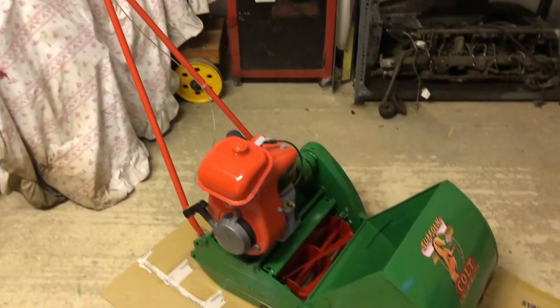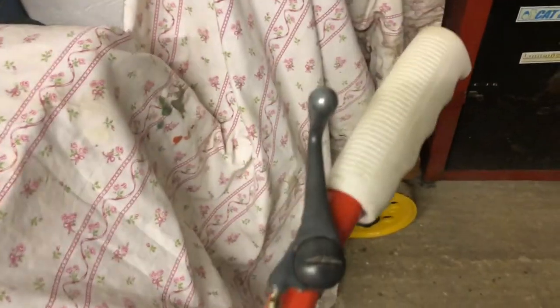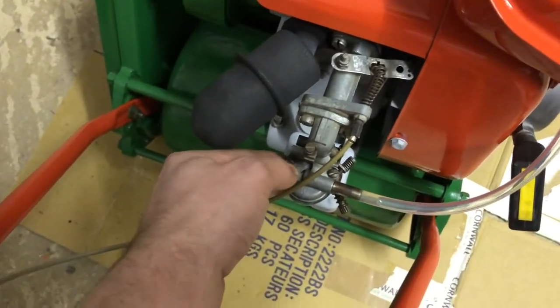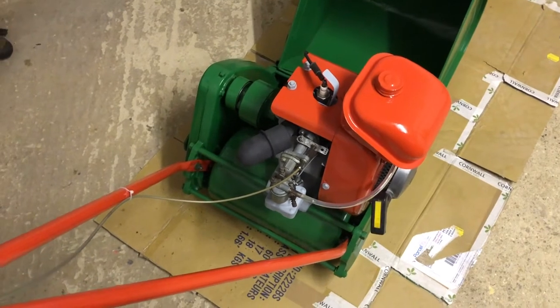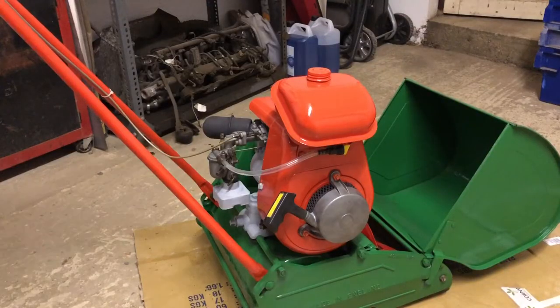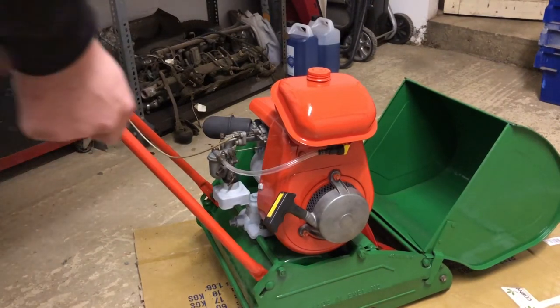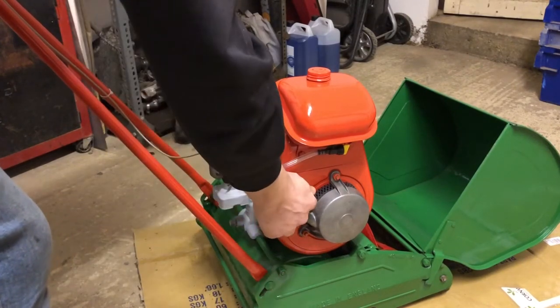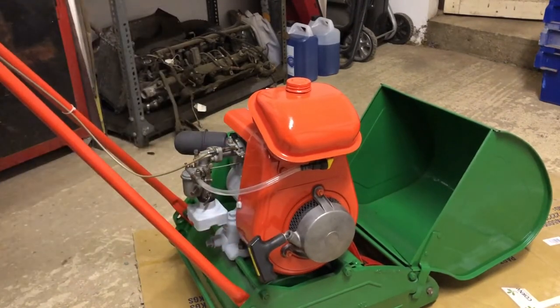I got home early today and I've finished the lawnmower. So we're going to actually see if it runs now - let me show you what it looks like at the moment. Throttle is now on, the engine is bolted on. So let's switch the petrol on, let's prime the carb - see it going through. Give it a bit of throttle. Now this hasn't been running for a few weeks, so let's see if it will just fire up nice and easy. This is either going to go very well, or not very well - it'll be one of the two. Alright, let's start it. Ready? Boom - first pull!